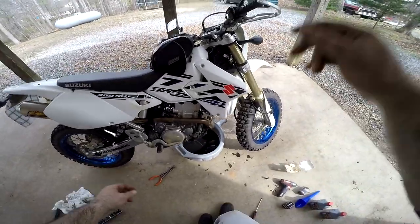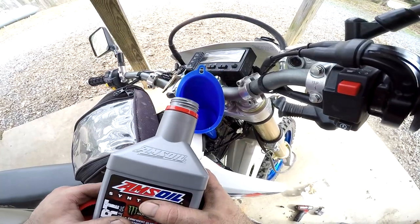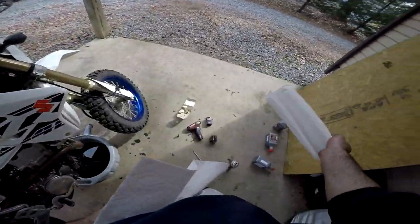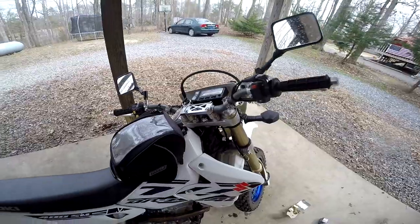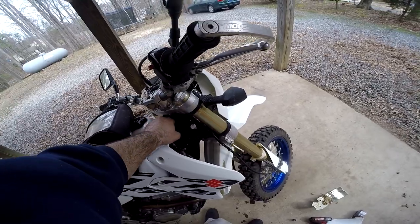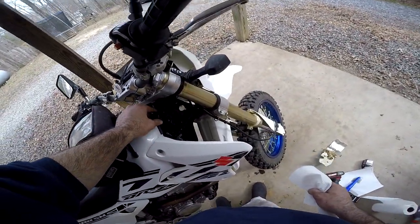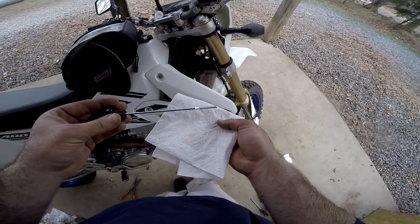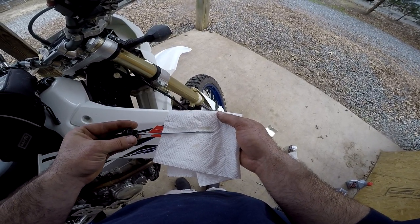All we have to do is add oil. I'm going to go ahead and dump the whole two quarts in. I'm a firm believer that slightly above the full mark is actually probably better. Make sure your funnel is clean. Now that she's been running for a bit, I'll show you how to properly check the oil level. You check it when it's warm — take the dipstick all the way out, clean it off, drop it in, do not thread it, lift it out and see where you're at. We're slightly over. You can also put the dipstick against a paper towel and compare lines since the oil is so clean. That's what we want.